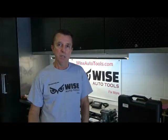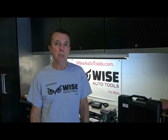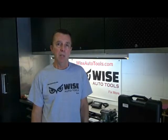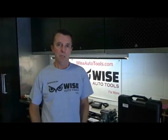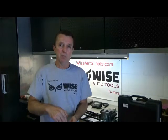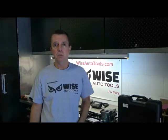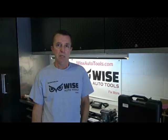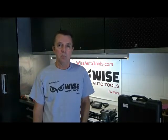But if you're working on say a Ford Mustang with a V6, then the 4412 would probably be your best choice. If you're working on an import that has a four-cylinder with long spark plug boots where the well goes down several inches before you get to the spark plug hole, then the 4412E is going to be your best choice.